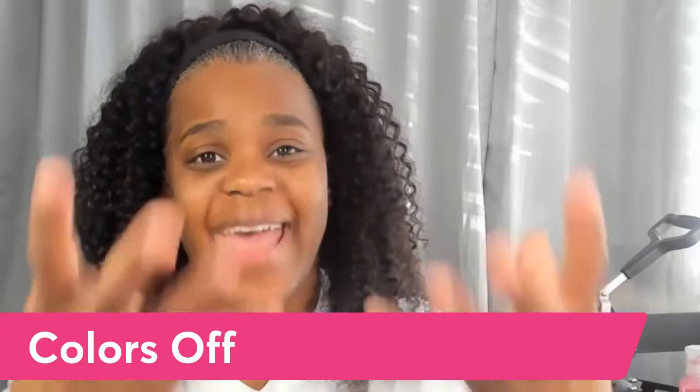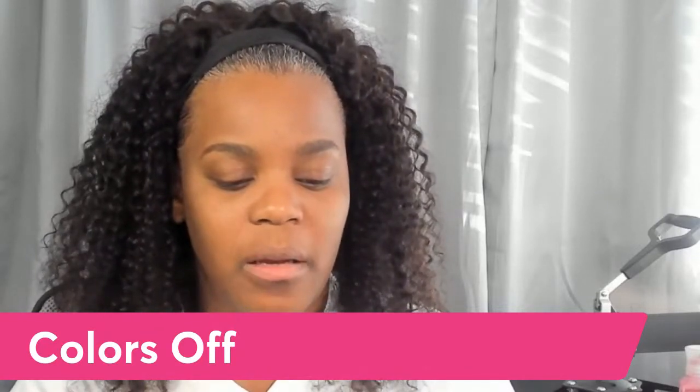The next one is going to be your print settings. Premium presentation paper matte, premium matte, and things like that put out a lot of ink. It becomes overly saturated with ink. So that's going to affect your colors because it's putting down too much concentration of it. Your magentas, it's already the most powerful color in this whole setup. It takes over everything. So if you're using premium matte and it's oversaturating, those colors are going to come off. It's going to be more like red tones, and your yellows can be orange because it's going to put down so much magenta.